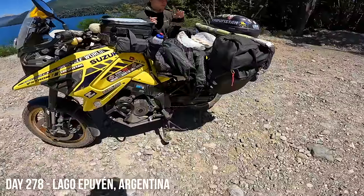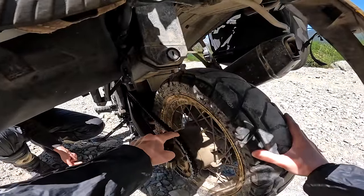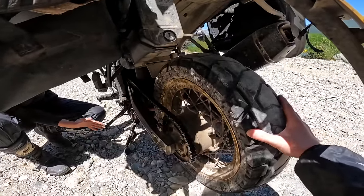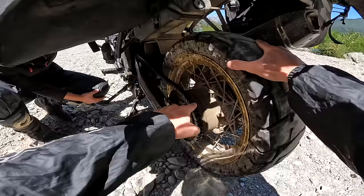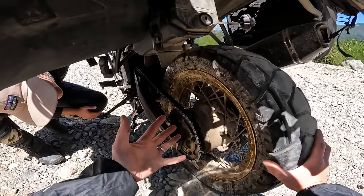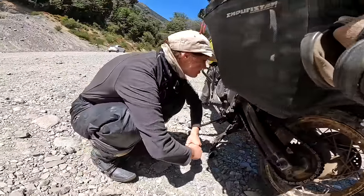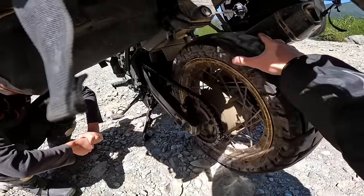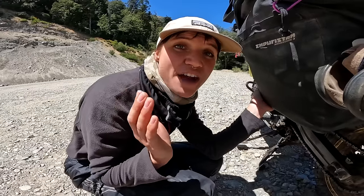Oh my lord. We also discovered something really, really worrying. Normally the chain has this little metal gasket ring, this little roller in the middle. And when we were at the hostel, we were giving the chain a bit of a clean and oil, and we found out that at least three or four or maybe even five are missing this roller. So this one, this one, this one, this one, and this one, there's like no roller there anymore. It's just the metal in between. Oh yeah, there's one here as well. So basically it looks like our chain is breaking. We had a look online to see how serious that was, and of course the advice is get that changed as soon as possible. Just important now that we make it for another 1,600 kilometers.